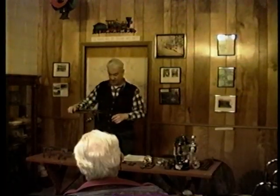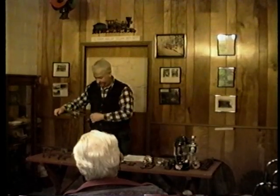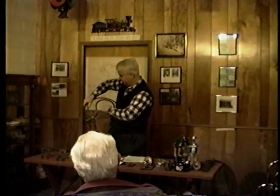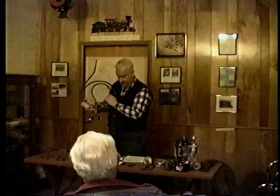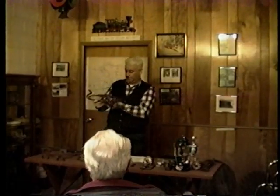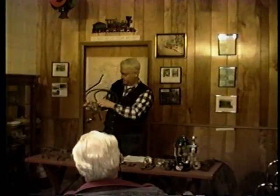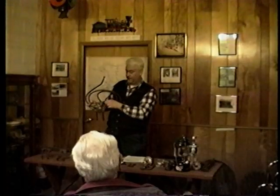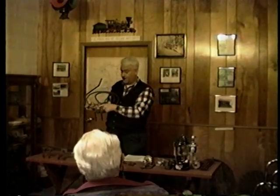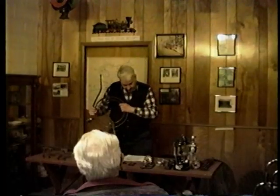You guys might not think that that's such a great idea, but I've had them choke up, so that's a great idea. And they also had this piece of cast iron that was put on top of the vaporizer itself, and the pilot lived right here all the time. So the pilot burnt all the time, and that piece of cast iron, which should be really longer, but for some reason it isn't, spread the heat out on that little piece of pipe, and also sort of protected that little piece of pipe. So if it was going to crack, it would probably crack there from the constant heat on it all the time. So that's another improvement they made.